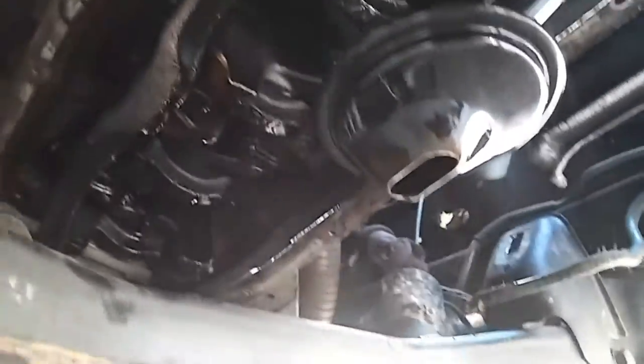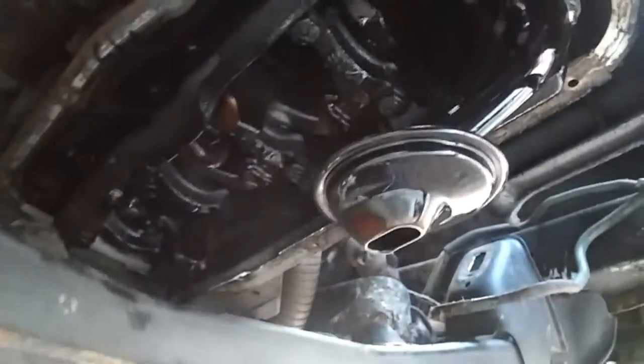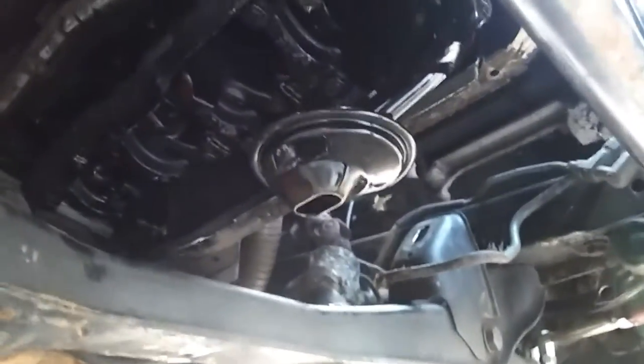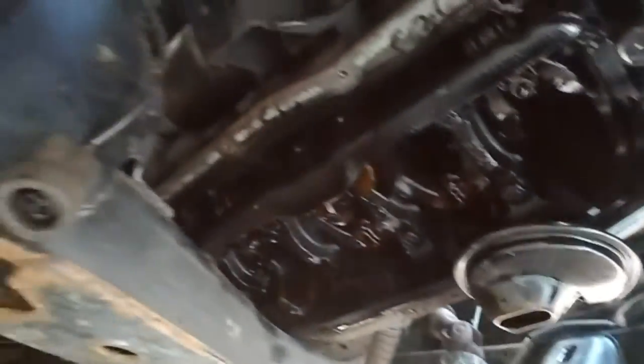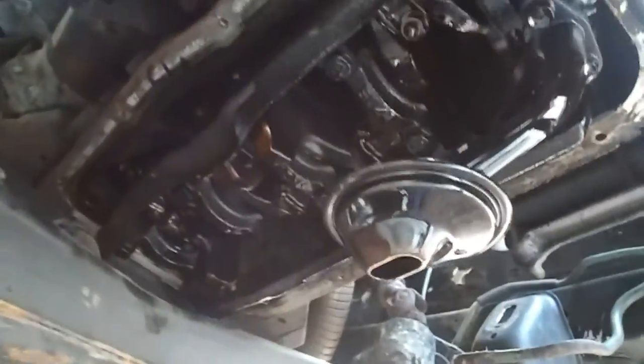The engine is looking fairly healthy. This is actually the first time I've ever looked inside my engine, but she's looking pretty good. The sump is not damaged — I took my time and got the oil pan out because I did not want that sump to be bent, otherwise I'd have a whole other problem. Now I just have to clean off the surface — all the old rubber silicone gasket — and then put the other oil pan on.